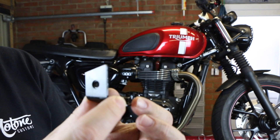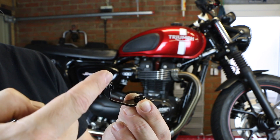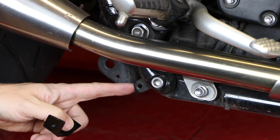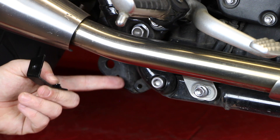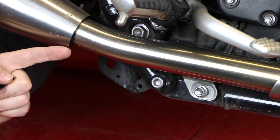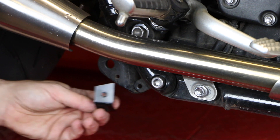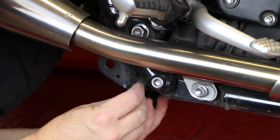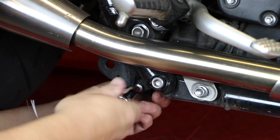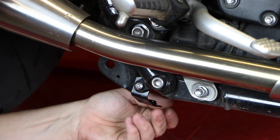So the first part we can fit is this little L-bracket that goes on the right hand side at the rear. It's fairly easy to work out — you've got a longer edge which goes at the bottom, this one mounts to the tab at the back, and you have the bolt that goes with it. This bracket bolts to this little tab here; if you're running with a side stand you've got to refer to the instructions because there might be another bracket that you need to remove. This kit also fits on the Street Cup, the Thruxton, and the T120 and T100 so there might be slight variances, but for the Street Twin it's fairly straightforward. This plate will sit behind this tab and you've got a T27 Torx head bolt that goes in there. I wouldn't do this up too tightly at the moment because you've got to move it around to get it to fit, so I'm just going to leave that in there loosely.